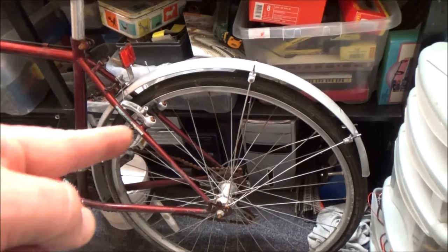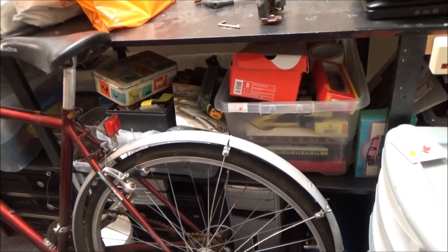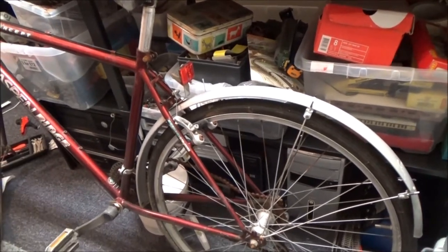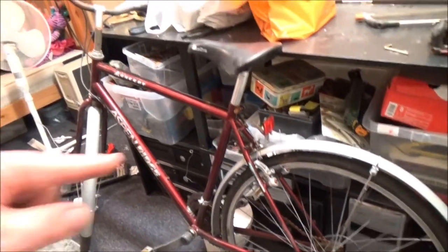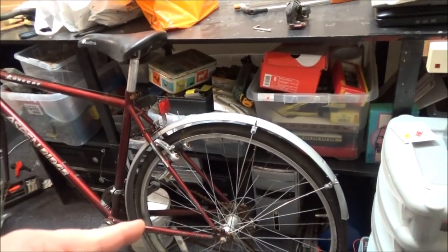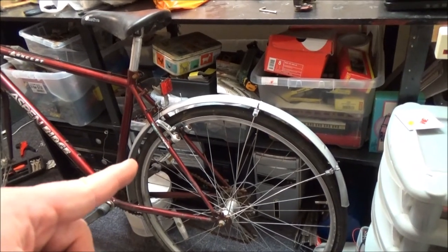I need to look at the back wheel — that's one of the first things I need to fix. Not sure if the wheel bearings are completely shot, or if they're just loose and I'll get away with tightening up the bearing cones. The chain is shot, so I've got to change that. The rear brake cable has actually seized, so I've got to change that too. And I need a tube — either put a tube in the back wheel or fix the punctured one. I may need another tyre, so I've brought a spare one home as well.